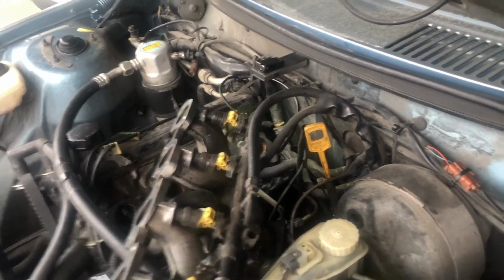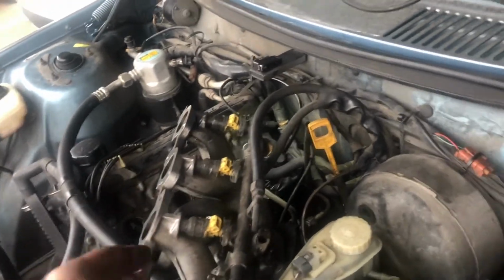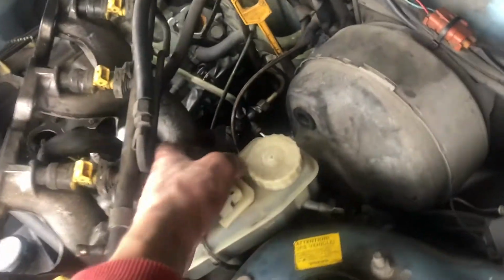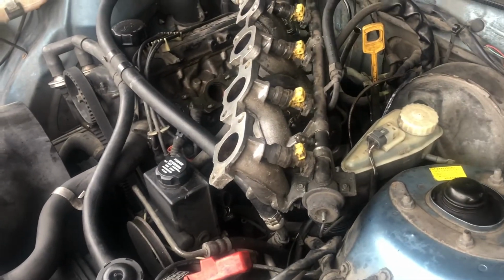And I know there's a lot to do with this intake manifold. It's got to go back on. I have to thread all the hoses and the things on, and then after you attach the EGR, for which I have a gasket maker because I don't have the right gasket. This one crumbled as I took off the EGR, probably due to such high temperatures.